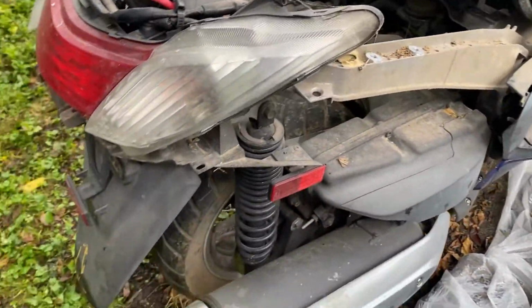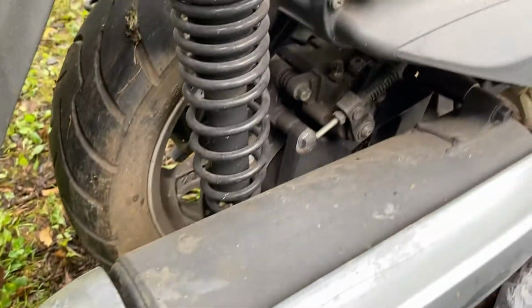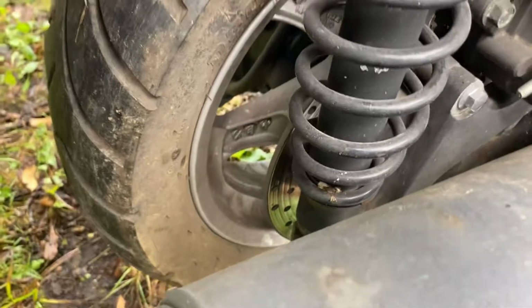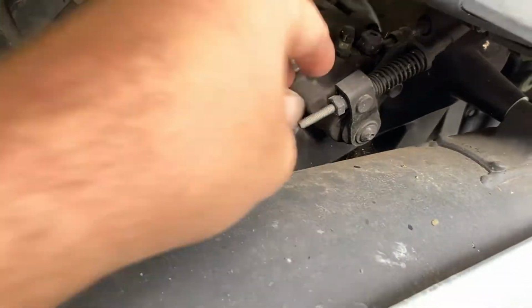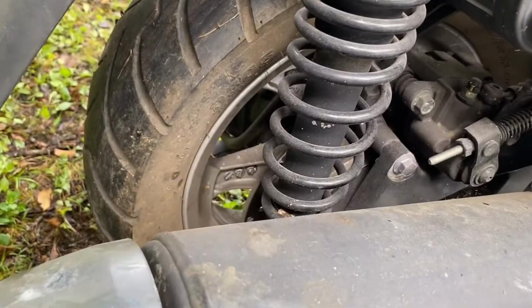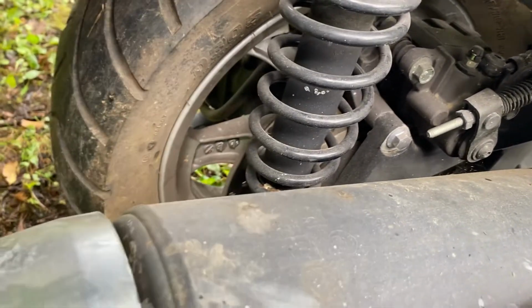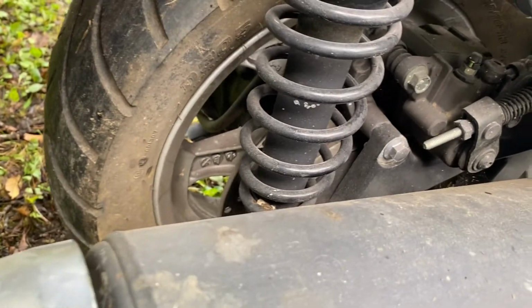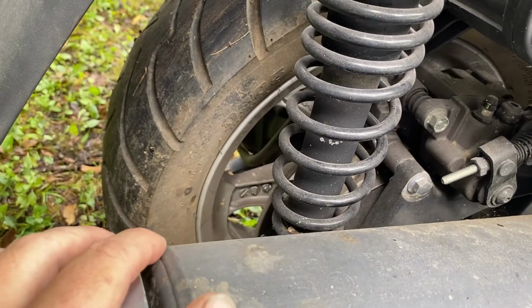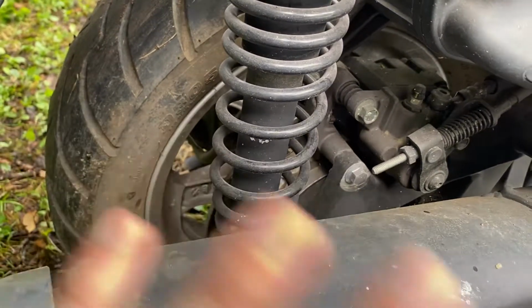Now, on this bike, the rear disc brakes are on the exhaust side. So if I'm going to retain the Yamaha's disc brake system, then I need to keep the swing arm on this side of the motor, which I know a lot of Ruckus people will be like, oh no, switch it over to the other side. Maybe, we'll see. I want to actually get this switched over to the Ruckus first, and then I can start worrying about the beauty aspects of it.